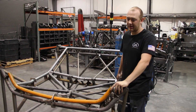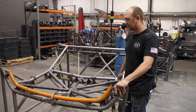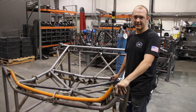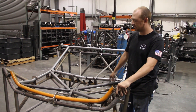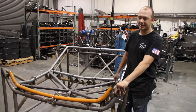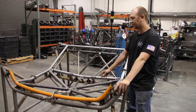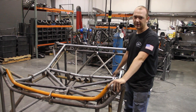Hey, it's Carson Braun. I'm a fabricator. I do the roll cages for the rally fighter chassis. This is one of our prefab roofs. It's got all the tabs on it to mount the body, the sun visors, our center console lights. Everything protects you in a crash. It's got the crossbars and window bar and everything. So get ready to weld it up and pop it out of the jig.